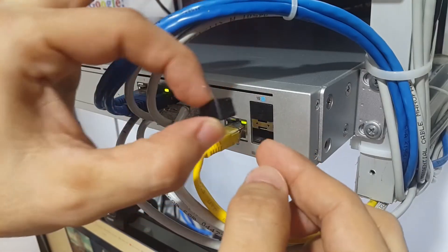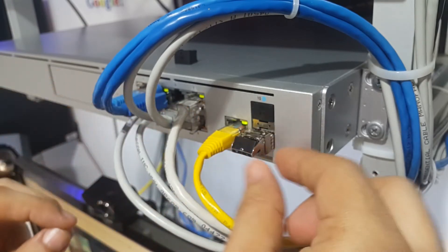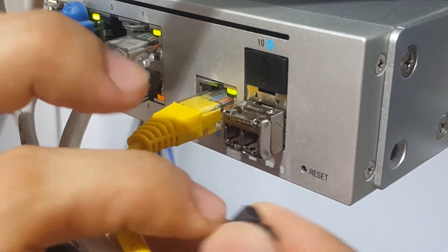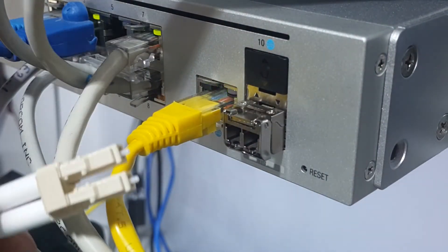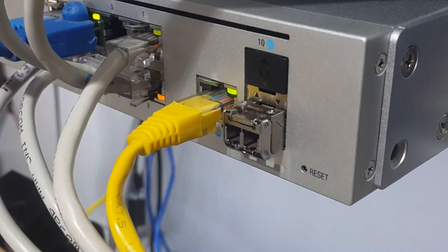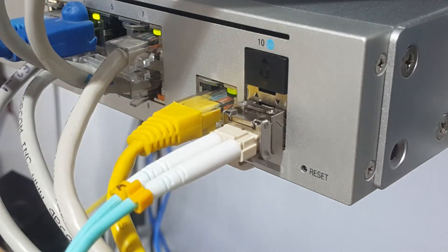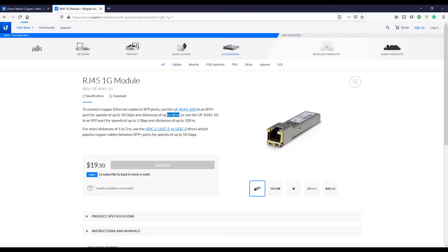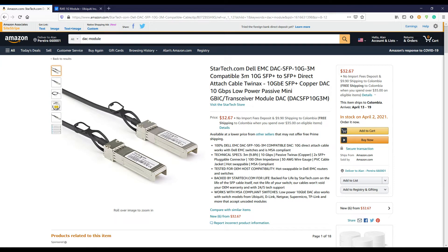Right here we're going to free one of the SFP Plus ports in the UDM Pro to use with OM3 cable. Remember that these modules support hot plug and that you can connect not only the fiber SFP Plus module, but also the RJ45 copper SFP modules, which by the way give you a maximum length of 30 meters over CAT6 cabling. A third option, and very commonly used, is the DAC or direct-attach copper — this cable consists of short-length copper cables mostly used in racks and server rooms.